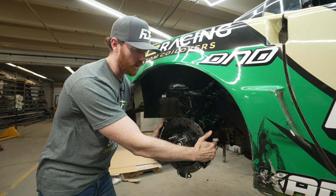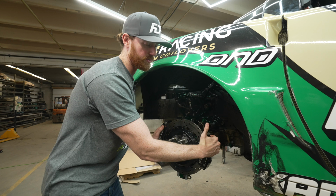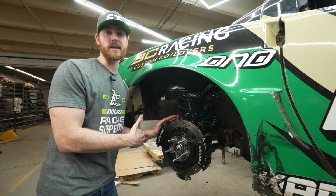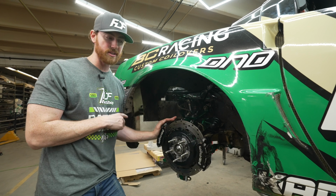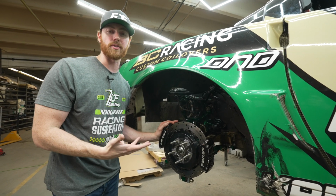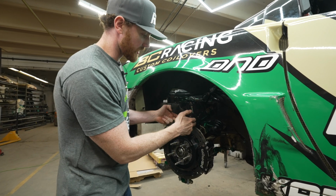You're going to have dual caliper options for dual Wilwoods. You're going to have the option for a factory brake and a Wilwood as a secondary, or you'll be able to run just the factory brake. 3 options. It's going to open up the door for what is available in terms of rear grip kits for this car. The other point is the camber adjustment.